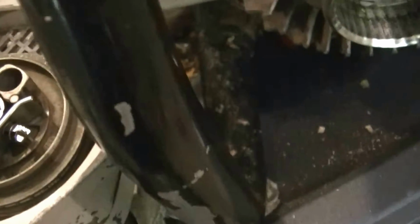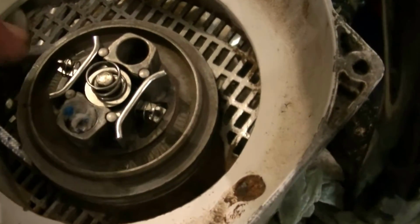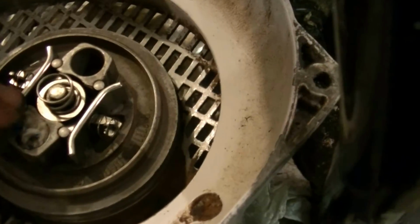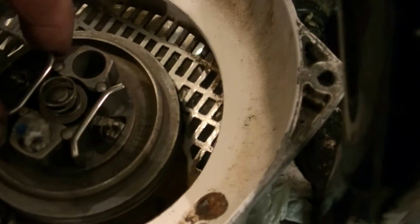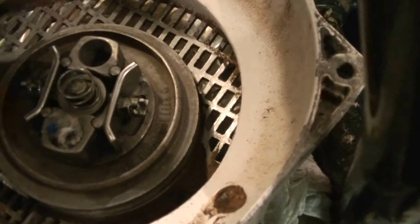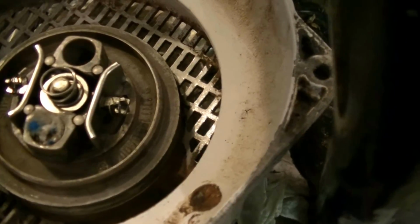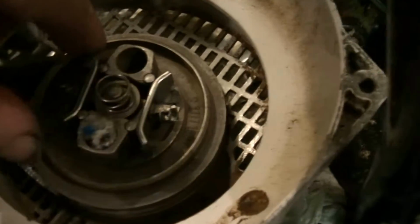I've got a wee tiny bit of lubrication on a brass bushing down inside there. The rest of it I got perfectly dry, because there's two friction discs that have to face in to trap this mechanism here. And if they're lubricated, or if the washers are in backwards so that the friction is out, then the recoil can pull out without engaging the dogs.